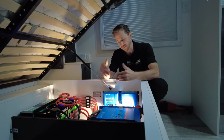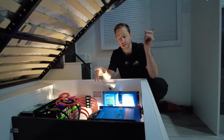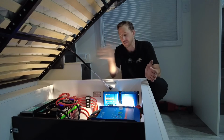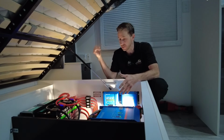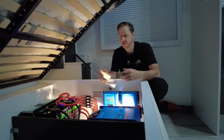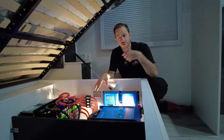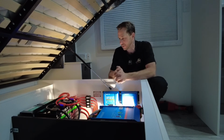Well, that doesn't work with the Victron. With the Victron, you can tell what it pulls from the input, from the controller, and it's all done up there. So the transfer switch in this is automatic as well, which means if he unplugs power or the generator turns off, this will automatically flick over to batteries. If it needs more power than that 2400 watts that you've set for this on the input, it'll supplement the rest of it with battery power. It's very clever. So none of these generators that bog down and clip off, now that won't happen with the Victron. If you set that to suit your generator, it will only pull from the generator what you set it to. It's very simple, and it's all up on a touch display, which I'll show you guys in a second.